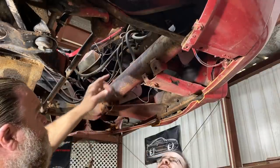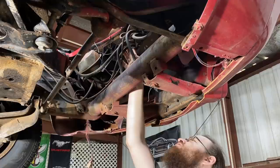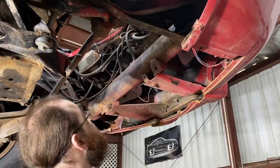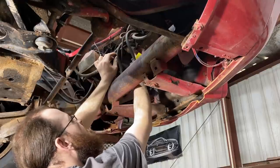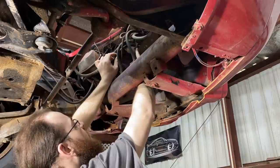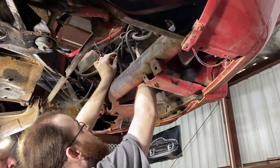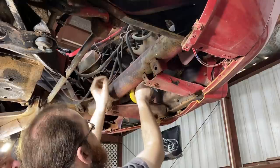Oh, it's already coming out right here. Nope. Step around here and look. Right. I'm seeing a leak right here at the joint. Yep. Now, is it coming out of that box, or is it coming out of a hose? Hard to tell here. That is coming out the bottom vent on the box here. See how if I put my thumb there, or pinky, it kind of disrupts that airflow. Right. Yeah, that's coming out the bottom there. Okay. So, tag that guy.